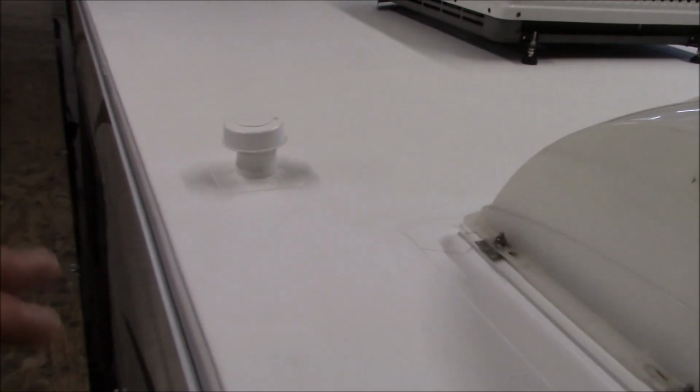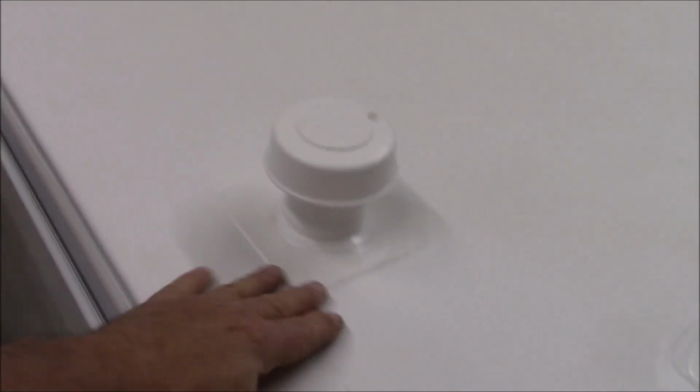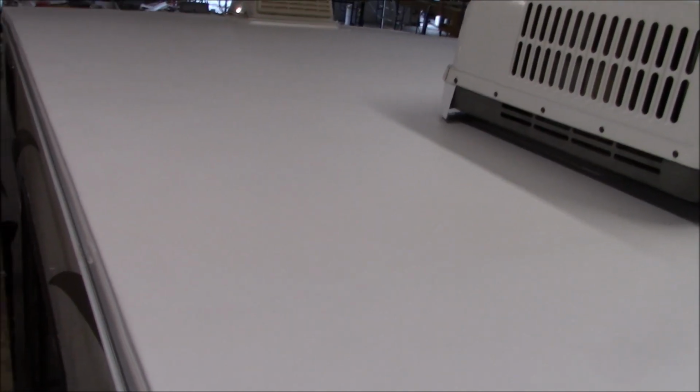So getting back to what the roof is, it's a 60 mil commercial grade TPO. TPO is thermoplastic, so that means it can weld together. You take a hot air gun and all of this literally fuses together like you would weld two pieces of metal. The difference is, when you weld metal, you usually have a medium, like a rod or wire. On this, it doesn't. When you heat it up, it literally just is like plastic and it fuses together. It's a very expensive heat gun, and it puts out an incredible amount of heat, so I wouldn't recommend any of the ladies use it as a blow dryer. It may fray some ends for sure.